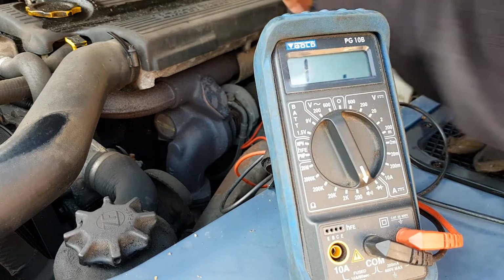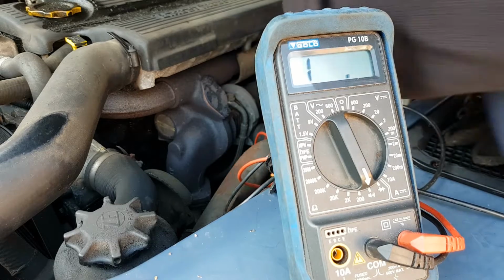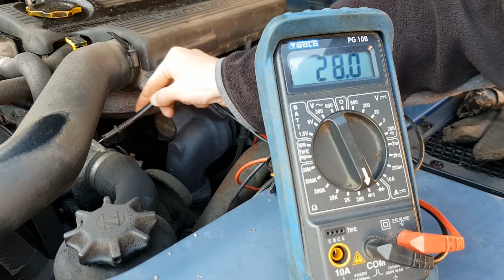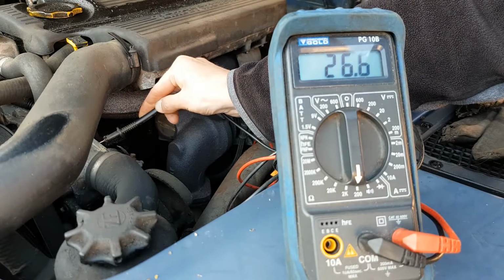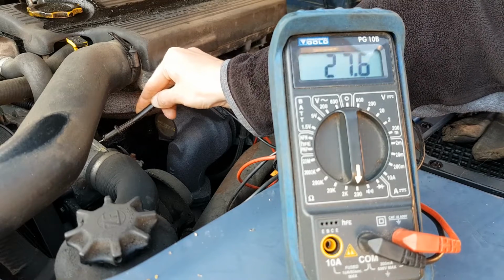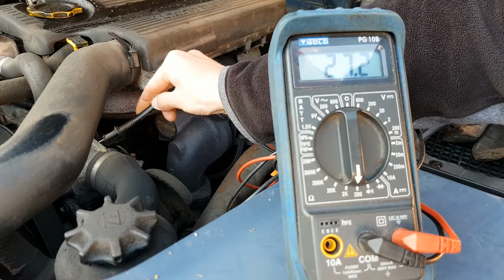The other one is to the instrument panel. So if I plug into that one, then go to continuity, I'm getting it, but it's quite a high continuity, that's sort of 26 ohms resistance. Just kill the beep. That feels a little high to me, considering it's only gone through the instrument warning binnacle. So I'm going to investigate that now.